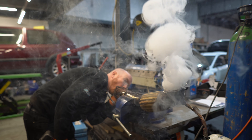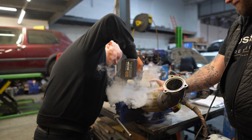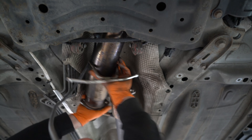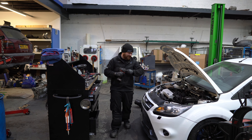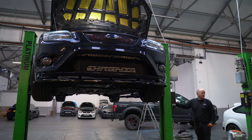You're all probably thinking: why on earth are you drilling a hole into your Air Tech downpipe? Well, to plug in the AFR sensor we had to make our own custom hole. I didn't know in part two we'd end up purchasing a new exhaust system alongside a sports cat that already had one in it — but what a legend Ben is for giving it a go. What's next? I've done the lambda sensor. I've got to put the downpipe back on, then we can put the oil in, run the car up to temp, check all the gauges, and then we'll be moving on to some brakes.